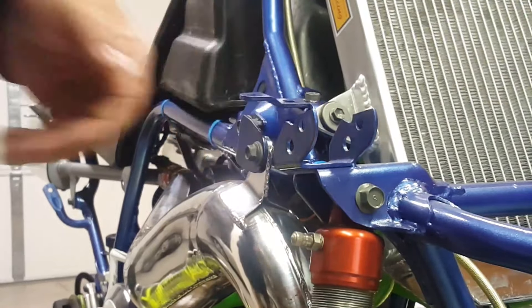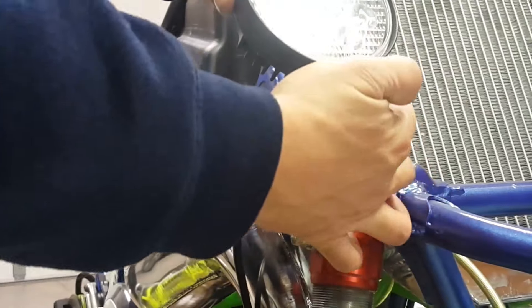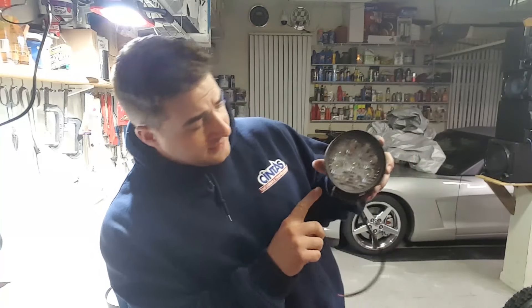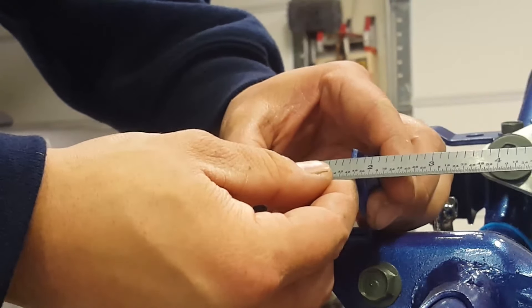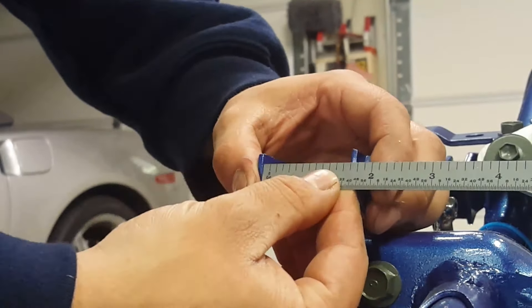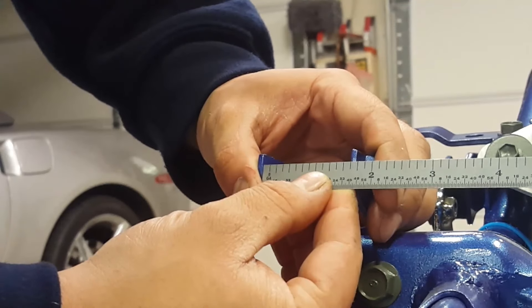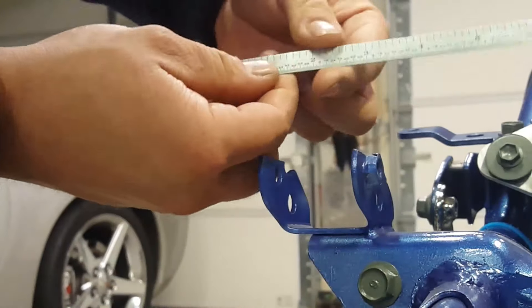The only thing we have to do — they almost fit perfectly in the brackets on our frame. Now mine, it looks like the previous owner chopped down the mounts where the lights go. It doesn't mean it won't fit if they're not chopped down; mine probably just needs a little less modification. You need to shave down the sides here just a little bit. So what I'm going to do here is just measure our gap — looks like it is one and five-eighths inches almost exactly.